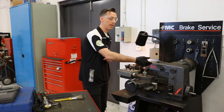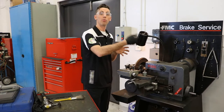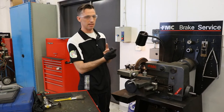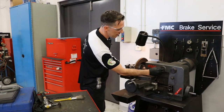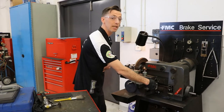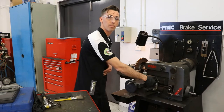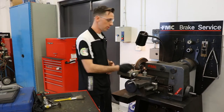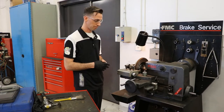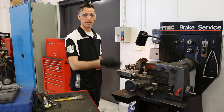At this point, I have to decide if I'm going to do a rough cut or fine cut. We always begin with a rough cut — a rough cut can be taken faster and a fine cut needs to be taken slower. So here I'm going to turn my feed dial up a little bit higher towards the coarse end and put it in the right gear for what we're doing. We have the option of drum or rotor, and here obviously we're cutting a rotor — so I'm going to pull it into the rearward direction for rotor. As you can see, the feed automatically draws itself out.